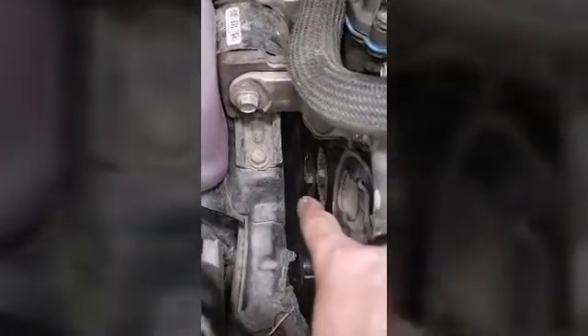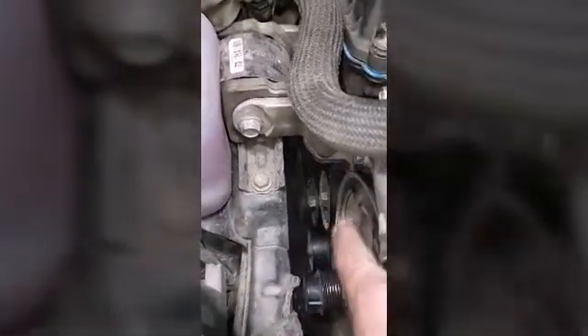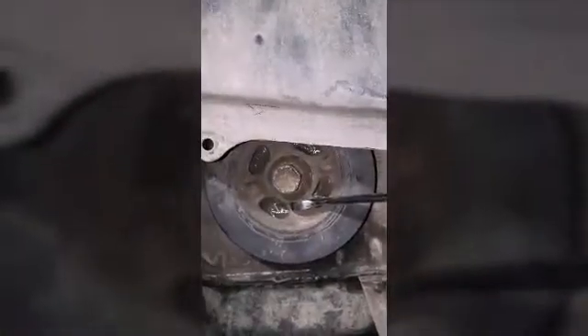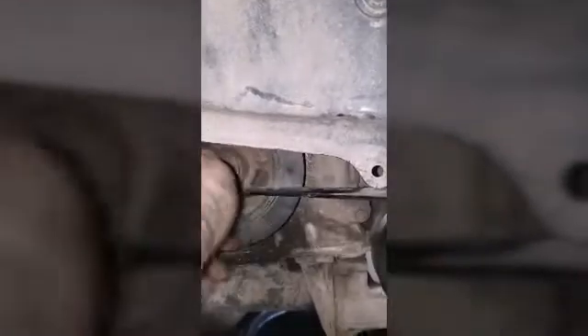Now that the belt is off, you're going to have to remove the top idler pulley, the lower idler, and the tensioner itself. Those should all be 15 mils. And then I believe for the tensioner, what's holding it on is a 13. All the pulleys are now off, so you can see your timing cover's all free to get at. Now you want to take the underdrive pulley. I know a lot of people will say this is wrong, but I've done it multiple times on this car - stick a wrench in there, when you turn it it hits up against the frame, it binds and you can get it loose. I've already got it loose - undo this nut and pull that off.